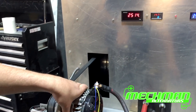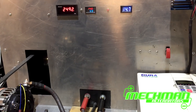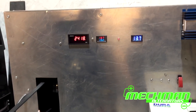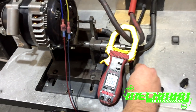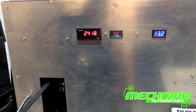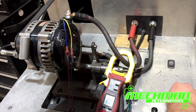It is warm — probably about 120 degrees — we'll get a lot hotter than that. We'll throw some load to it and we're up to 202 amps — easily doing over 200 amps. It's maxed out probably still coming up a little bit — it's getting pretty hot but well over 200 amps at idle at 2,400 RPM with 13.2 volts. That's really good for a 200 plus amp load at idle.